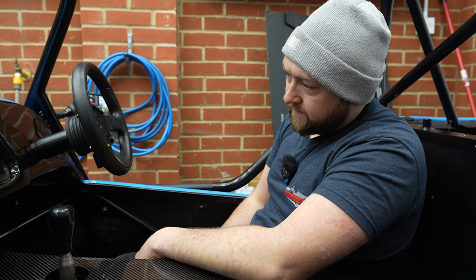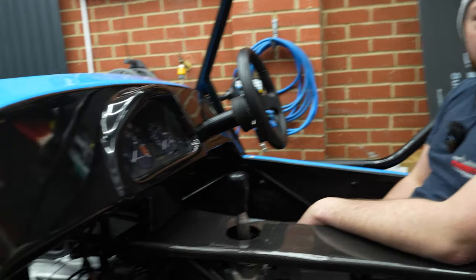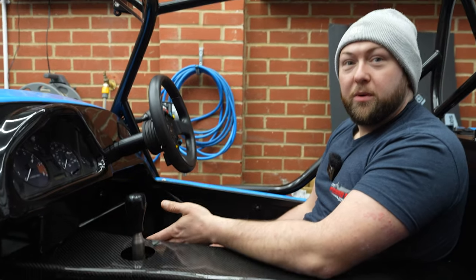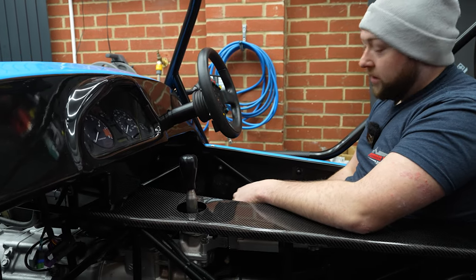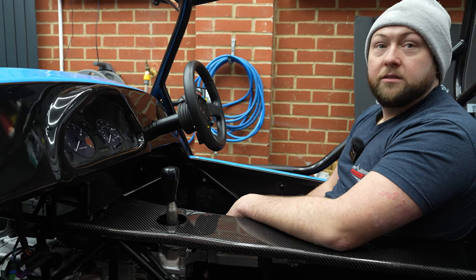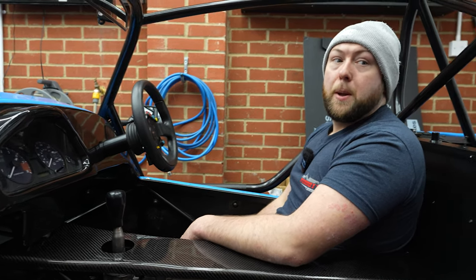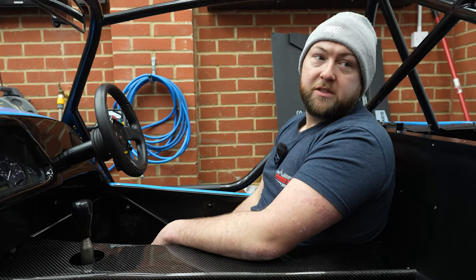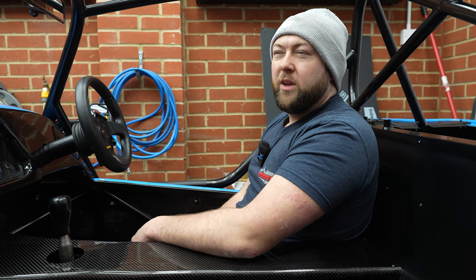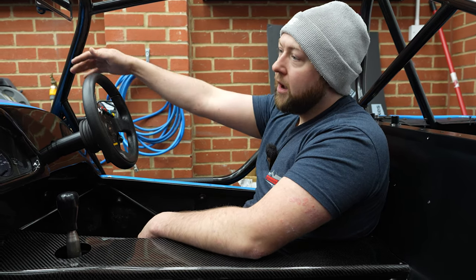So, what's next? What is left on our pre-IVA list? Maybe fitting seats, because we haven't actually got any seats. That would help. Other than that, nut caps and all the pre-IVA trimming around all the holes. Then work out everything we haven't done. Rear boot cover is done, it just needs putting on. Battery, coolant, those bits are done, but they got taken off, so we need to put them back on.